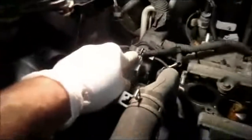And then we're going to lay our harness back in there and plug them back in. And then we're just going to clean off the manifold in here. And we're going to clean off the other part of the manifold, which is up here, and the water inlet. And once we get that cleaned off, I'll come right back. The next thing we did is we installed our upper hose coolant attachment to the engine. We bolted it down, tightened all the bolts up. We put back on the engine front mount, and we plugged in everything that was unplugged.